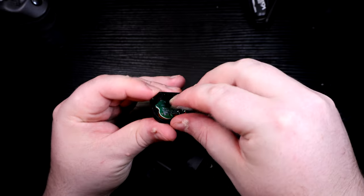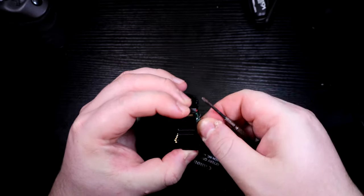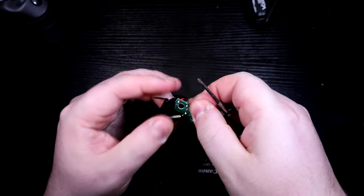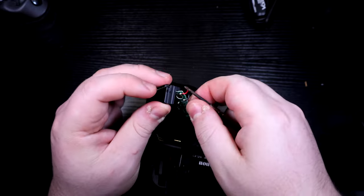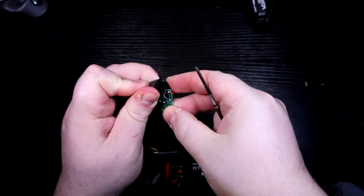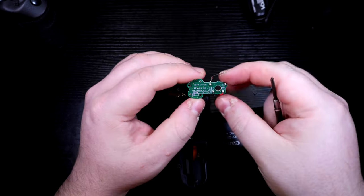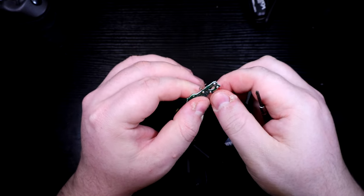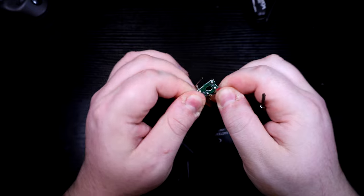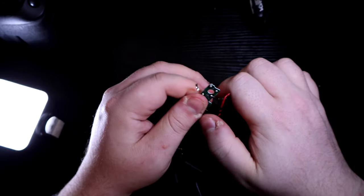Once I get this out, you will need to remove the connectors behind there. There are two little metal strips here which obviously connect to the inside of the 20D, which you need to maneuver out of the way. As you can see, all the pins have now fallen out. So if you did want to reuse this again in the future, make sure you're ready to capture all these pins that will fly out from the top, because the logic board is what holds those in. If you wanted to reuse this, you'd want to desolder these two parts here, but I'm not going to reuse them.